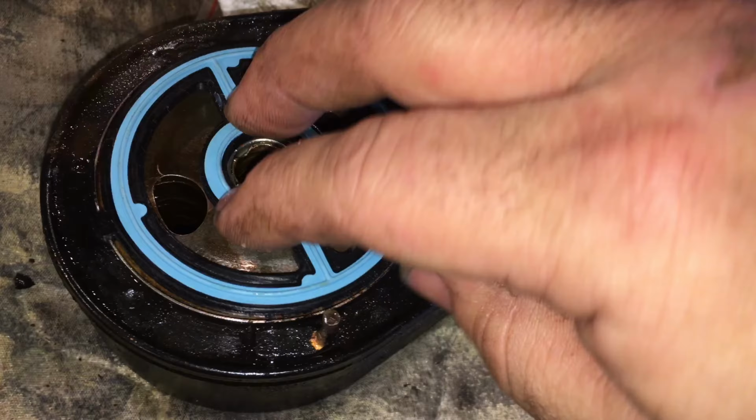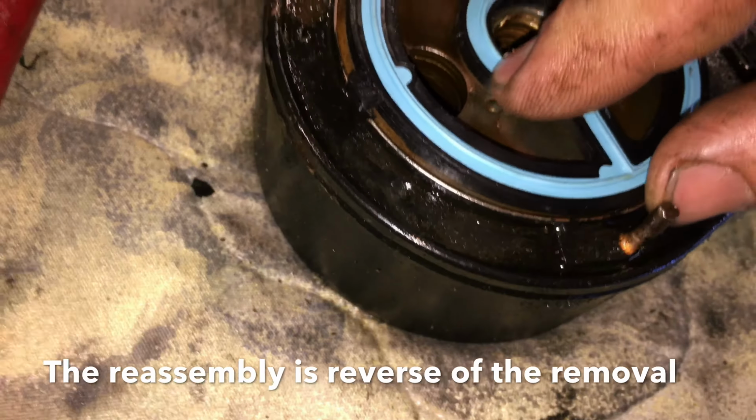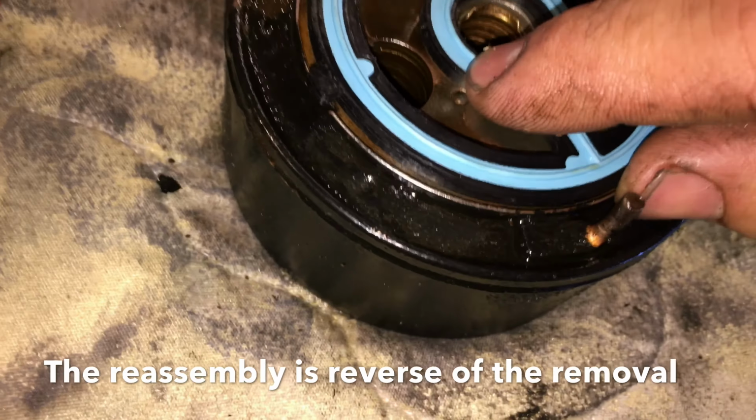And then the next step, of course, now is placing this new gasket on there. Now this has a ring in the middle, okay, which kind of surprised me. You see this ring here that spins? That does not appear to be removable. So what I'm going to do is I'm going to put this on, and it doesn't seem to quite fit right, right? Like it sits on that ring. Okay, so I'm gonna make sure it's centered where it belongs, and I'm gonna take a socket on top of the center here and just tap it in, and that should let that ring, which has teeth on it, grip in the center of this gasket. So we'll try that off camera because I only have two hands, and then hopefully that'll be the solution for that.